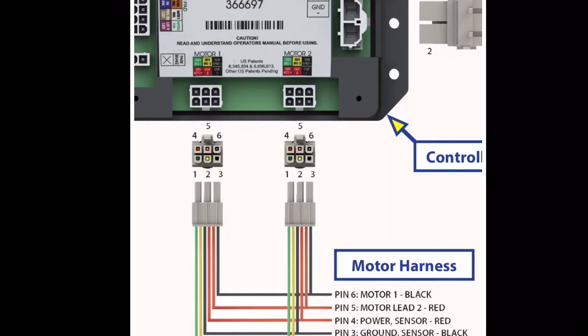We had a customer come in with a slim rack slide out in a motorhome and we couldn't set the stop point - it wasn't working correctly and we noticed there were some broken parts. So we got those replaced. We still couldn't set the stop point, and tech support thought maybe it was a voltage issue, which it definitely was not. It had to be the signal circuit, so I got the manual to diagnose that. This is a video on how to check that signal circuit.